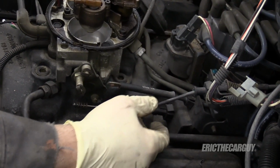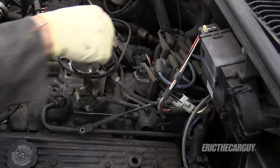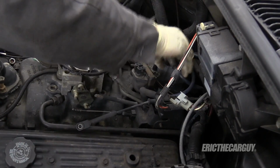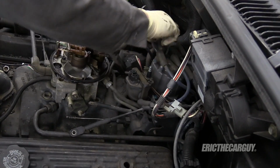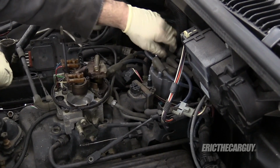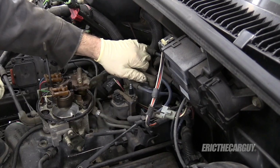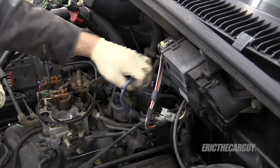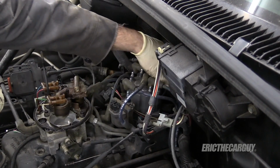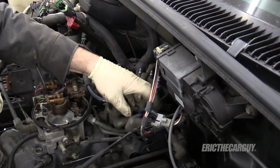And given that these guys are all in one bracket, I wonder, and I bet it's going to be a lot easier to see without this distributor cap in the way. In my experience with pulling Chevrolet engines, the first engine I ever pulled was out of a '63 Biscayne, if you don't remove the distributor cap on a Chevy small block, it will crunch against the firewall as you put it in or take it out. It's like a law of nature.